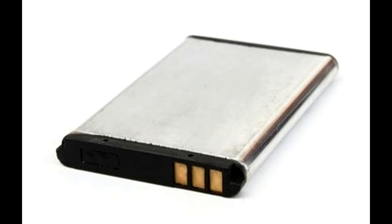Do not strain the battery. Lithium ion batteries, especially those used in laptops, prefer shallow discharges. Do not drain down the battery until your laptop shuts down or hibernates automatically. If you completely drain your laptop's or phone's lithium ion battery daily, you will notice a slight reduction in its battery backup.